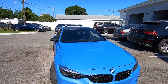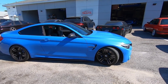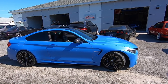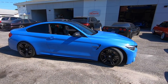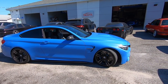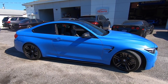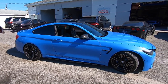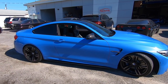I apologize for losing the footage from the video I just recorded — we kind of talked about the plans for this car and some of the modifications already done. Right now it's on a Bootmod3 stage one, probably makes about 500 to the wheels. I'm waiting on downpipes and charge pipes to come in so we can go stage two, and then we'll get Alpha to tune it. One thing I learned about these cars — you can go full E85 with the stock fuel system. You literally just put E85 in after the tank's been drained, then put an E85 tune on it and it'll make about 600 to the wheels.